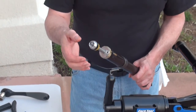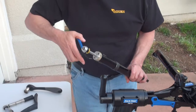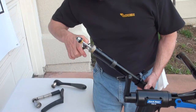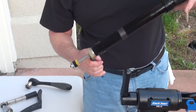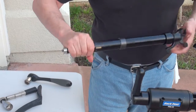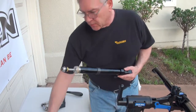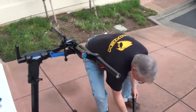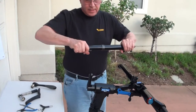We're going to take out the air spring to show you how to remove it and how to re-lubricate it. You use your pin pliers on the holes on the top cap and just back that out. Now, in order to release some of the air pressure, you might have to push down on the spring carefully — that'll release it. Now you can simply pull it out.